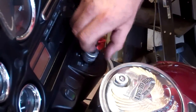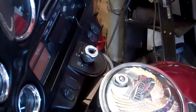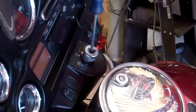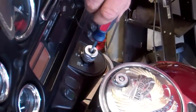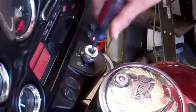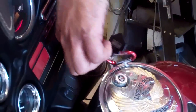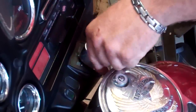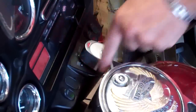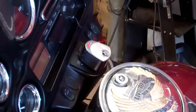Slide that down on there, slide that back, tighten it up, and then get your screwdriver back. With your screwdriver, you have full capabilities of going everywhere the ignition does. Now you go to the accessories position, put it back down, turn it, and now it's reinstalled. That's how you remove your ignition switch on a 2000 Harley-Davidson Electraglide.